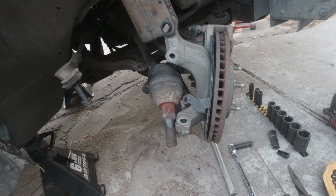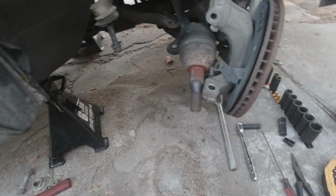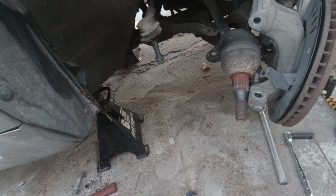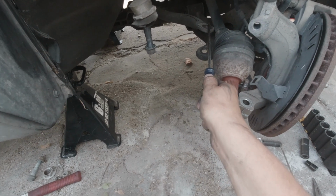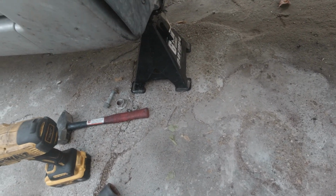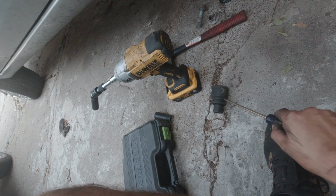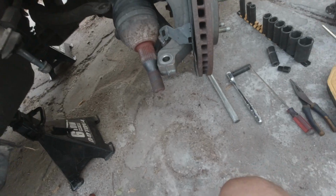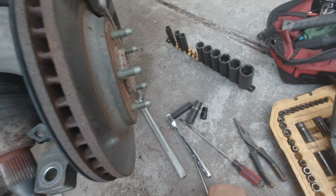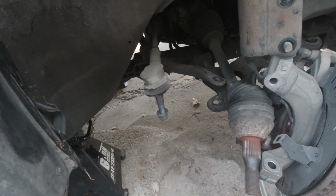All right, everyone, we got parts off here, as you can see. Outer tie rod, these are actually really good still. They're holding up by themselves. Outer tie rod off, sway bar link off, half shaft nut out. That was not a 35, but a 35 works. 1.25 isn't big enough, so I believe it's 1 5/16 is probably the correct socket size.